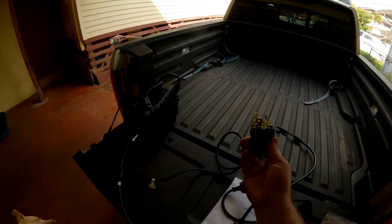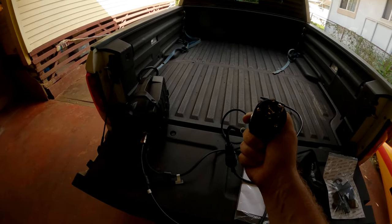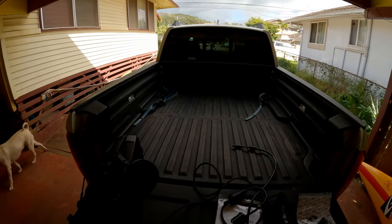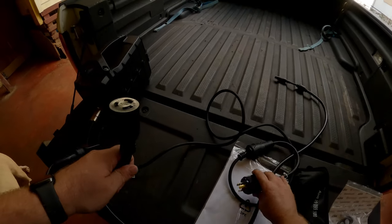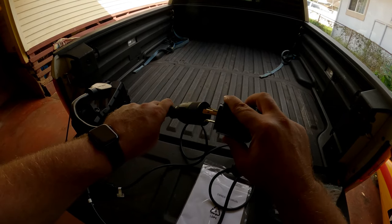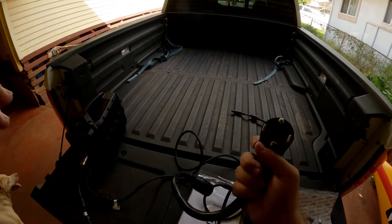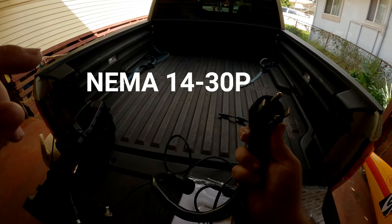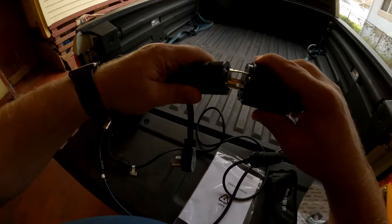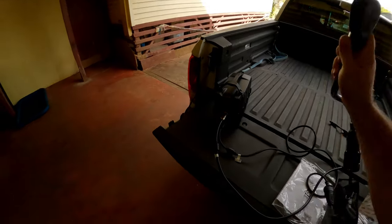If you don't realize this, you're going to be kind of screwed: the plug it comes with is a NEMA L6-20. Nobody's house that I know of has this plug — this is not a dryer plug, this is an industrial plug for 220V. So I had to buy an adapter off Amazon — I'll link it in the description. This is the NEMA L6-20 going into an adapter, and then this connects to the newer-style dryer plug. So there's a fourth wire, and then you plug this into the wall.